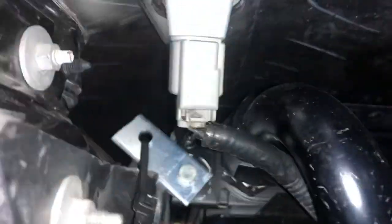It doesn't move that much. By doing this, the actual radiator sits on the inside of the bumper, and so with that bolt there and bolt there, I don't need that spacer anymore that keeps the bumper from compressing, because the bumper is actually bolted to the splitter. My two splitter struts are right there and there, and then of course it's connected underneath to the cross beam as well. So there's a bolt there and two struts. All that is tucked in there nicely. This fits behind it very nicely here.